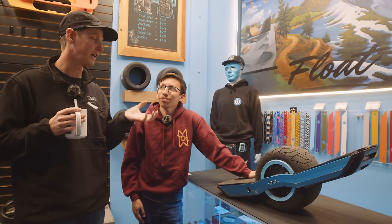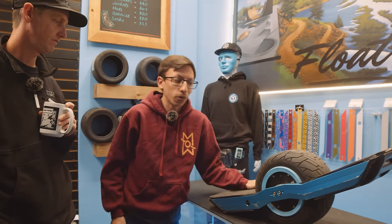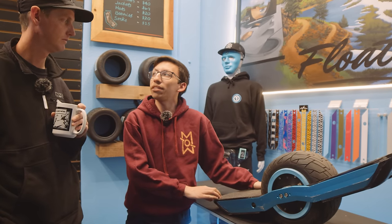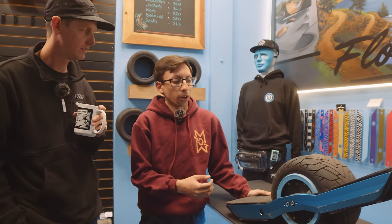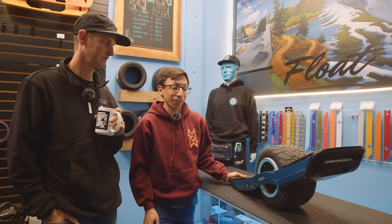What's the difference between the GTS battery pack and a 2p pack like this? The GTS is 27s 1p — that gets you 113 volts. Future Motion's idea is to limit how much current goes through the board, keeping the same current limits from their old boards. The high voltage just lets you get more out of the motor using those lower currents. But this is 24s 2p — meaning 24 cells in series and two cells in parallel, so the pack can put out double the current of one cell. You get a lot of torque plus a lot of voltage.